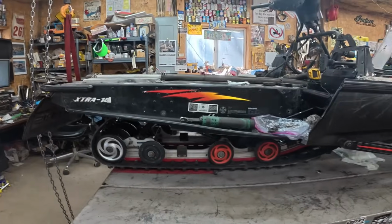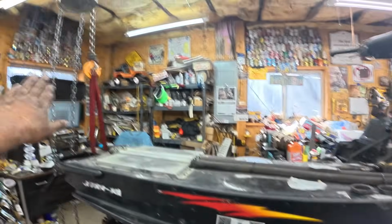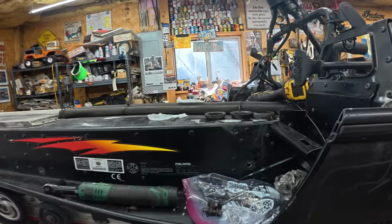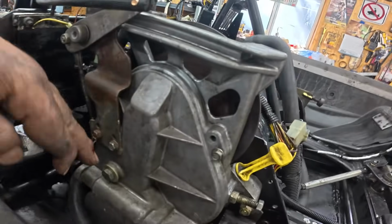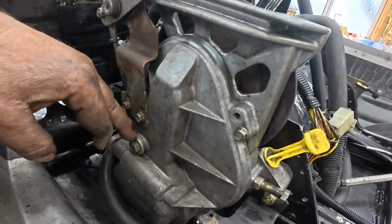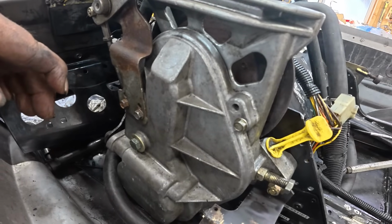All right, we're working her down in. We're just about to the ratchet strap phase, where I'm going to use a couple ratchet straps to pull the skid back to line this bolt up. I can adjust the altitude with the chain fall there, but do need to help pull it back a little. Oh yeah, and I did notice this. I forgot this bolt earlier. It's in the chain case now. So other than filling it with lube, the chain case is complete.